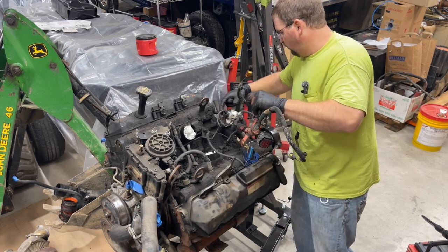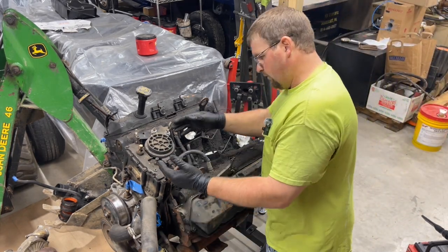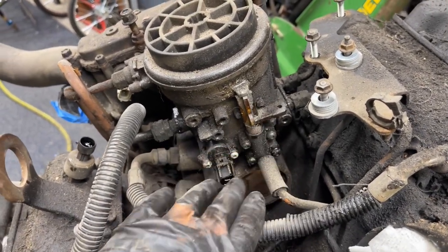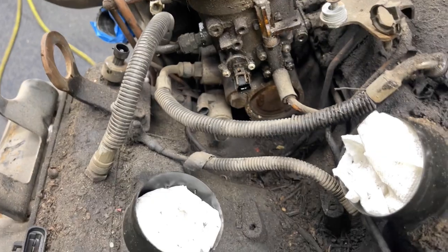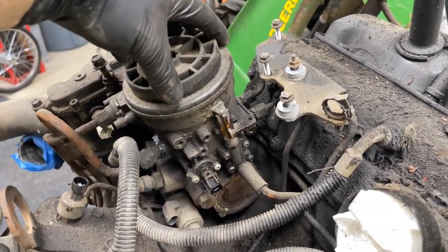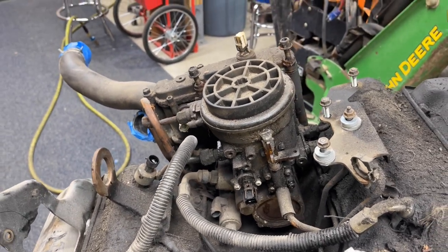So we'll have to do something with that fuel bowl. It's easier to keep this all together so you know where everything goes. The only thing left up here to remove is this fuel bowl. Let me spin this around so you can see a little better here. You can see how this looks all glossy hard — he had run some alternative fuels in this truck and it looks like it ate some seals, so we're going to have to do something about that. If you ever want to work on one of these trucks, this fuel bowl — even on the OBS trucks — it's always in the way. You want to work on the high-pressure oil pump? It's in the way. You want to do anything? It's in the way. I hate fuel bowls in the valleys of these trucks.